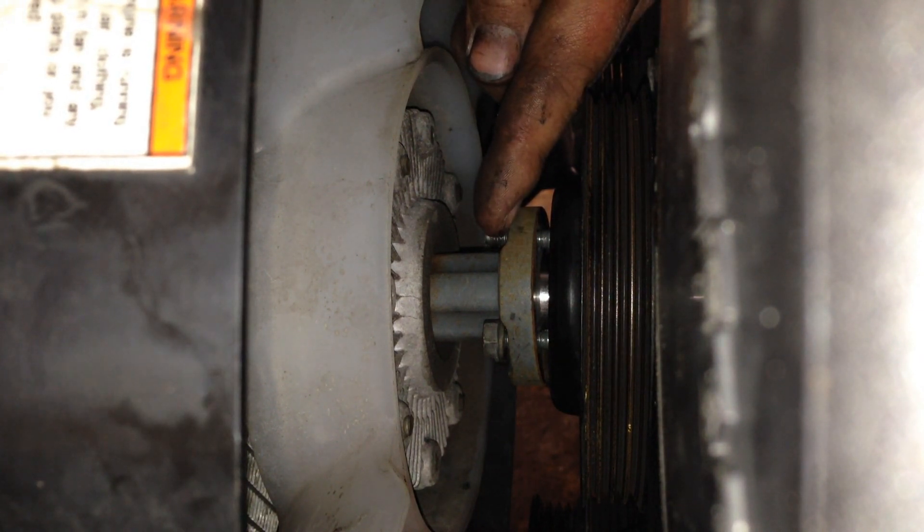I made a mistake. Before you put the fan on, take the fan off the pulley and put the fan belt on first, because otherwise you can't get it on. So take a new belt, put the belt on first. You can wiggle it in place. Now we have the belt on and then we can put the fan on.